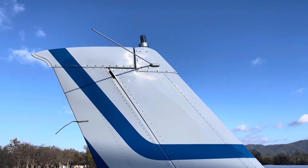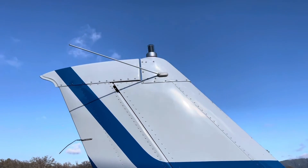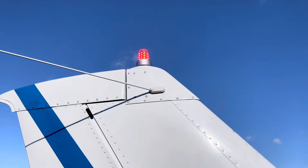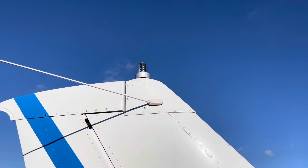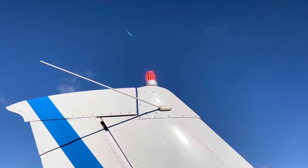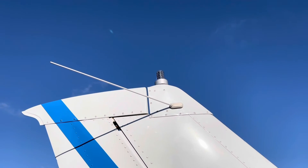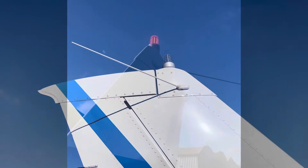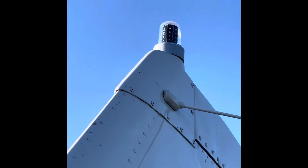As you can tell, it's not particularly difficult work. If you get your A&P to help you out, they'll probably come over at the end of the day, take a look at it, and help you do the paperwork and sign it off. A couple of other notes: the installation asked for four number 6 screws to attach the mounting plate to the plastic fairing, but we used four number 8s, which required modification of the plate — that's just because the mounting ring inside our tail cone already had spots for number 8 screws. Other than that, it's a pretty straightforward installation and a great improvement. This thing will last forever and it's brighter than sin at night — you'll love it.